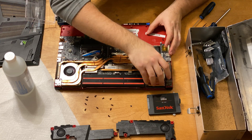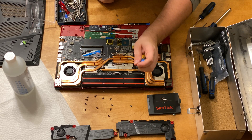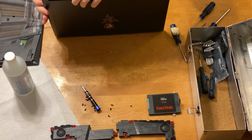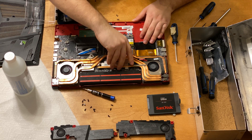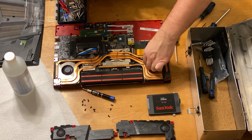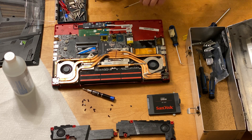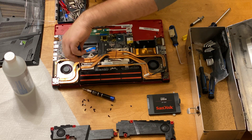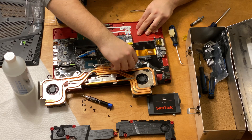To remove the heat pipe on top of the board it was kind of difficult because there is quite a bit of piping in the MSI laptop — they are cooling the CPU and GPU at the same time since this is a gaming laptop. I like to use a crisscross pattern when putting screws back in so that all the tension is on the chip equally, but when taking it off you can just remove each screw one by one. I was trying to lift it off but didn't realize there are two screws holding in the fans on each side. Once I unplugged the power supply connector I found those screws and was able to remove the fans.